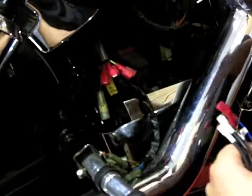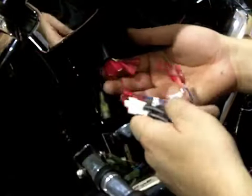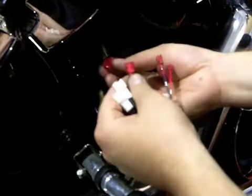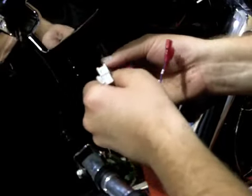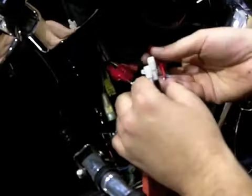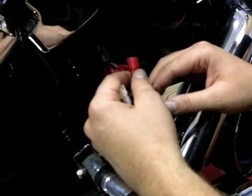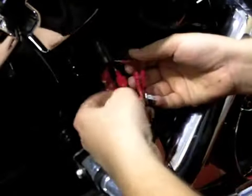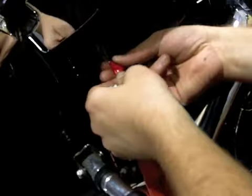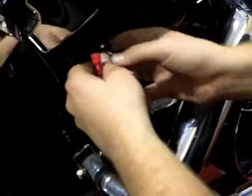These connectors run directly to the main frame of the motorcycle, and these other wires come from the turn signals and tail lights. So on the input, I'm going to take this brown one here, which is my right turn — that was my blue wire according to what we figured out earlier — and plug this one in just like so. This next one here is going to be my blue, which is my power for the rear tail light. Next one here is going to be the output brake, which we figured out was that green striped wire. And the last one is the left turn, which we identified as the orange wire earlier.